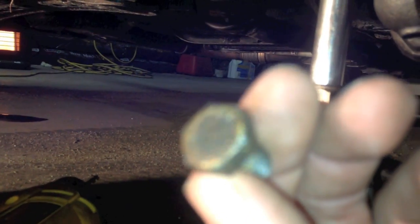So a minor setback here. When I was attaching the bracket, I over-torqued the bolt that used to be right there, one of these guys, and I snapped the head right off. So, I drilled a little hole, got an extractor, which tightens to the left and pulls the bolt out, and it just wouldn't come out. So I just drilled it out, so I have a completely new hole drilled inside there.